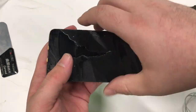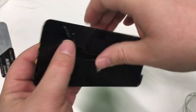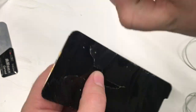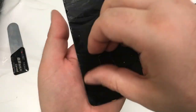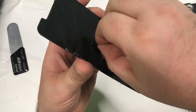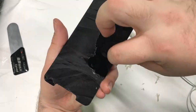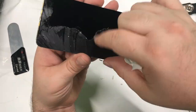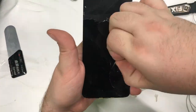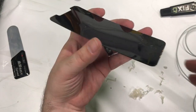There is a section of adhesive that stayed on the glass, but for the most part I'm going to have to clean up the display. There are a couple of ways to do this. I'm going to show the method that doesn't involve a lot of chemicals — simply rubbing or pulling the adhesive off. If you continue to pull gently, you should be able to remove the entire thing, or just small chunks one at a time. Using a little bit of acetone or alcohol will also help. Basically, I'm going to pull or roll off all the adhesive on this particular display.